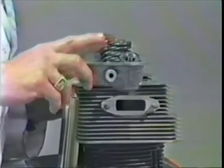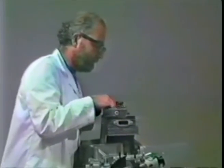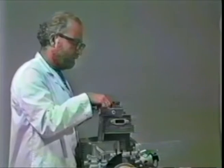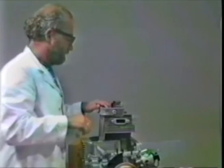One thing you should do before you do anything else, of course, is take a magnet and put it down through each of the holes of the head with the head off, to make sure there is no head nut washer down inside any of the holes. We've done that already. But take a magnet and stick it down with the head off the engine. Otherwise the stud will just grab the magnet. You won't be able to tell. Do it on all 8, but these 4 here are the most critical. If there's an extra head nut washer down here, and you put one of the regular head nut washers on, you have 2 on the same stud. It'll raise the stud enough that the valve adjustment goes to hell, and you have oil leaks. It's a real mess.